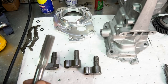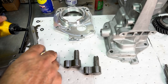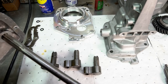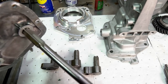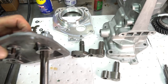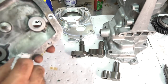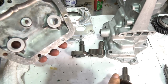Since these billet shafts are 750 thousandths or slightly oversized, I need a reamer to open up the bore of the side cover and extension housing. I'll fit it in there — it'll start on the bore — and you can do it with a socket at the end of your reamer. Just go in there and open it up, keep going until it comes through the other side, and when it feels nice and easy, pull it out. You'll see the shafts fit in nice with no movement — perfect.